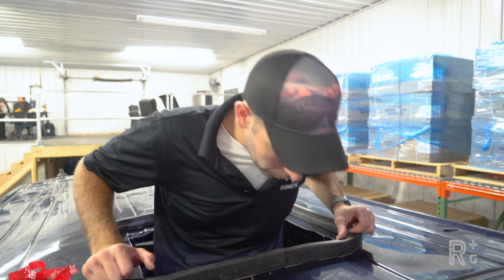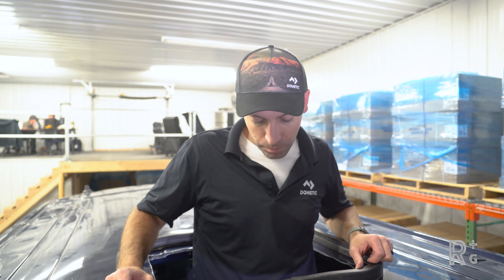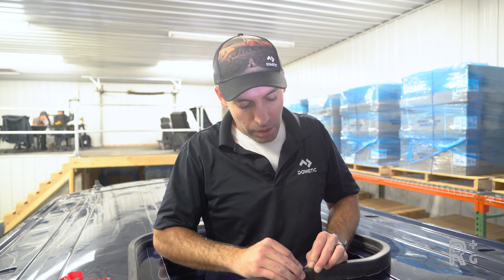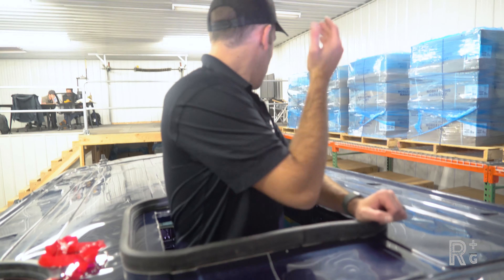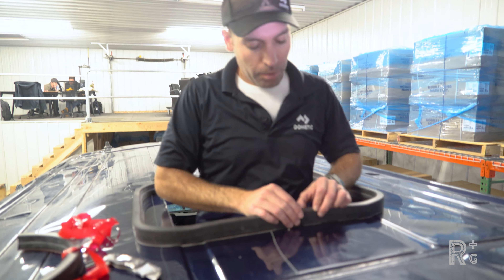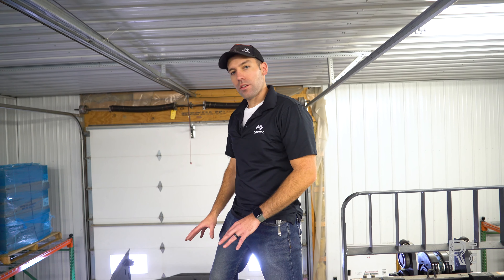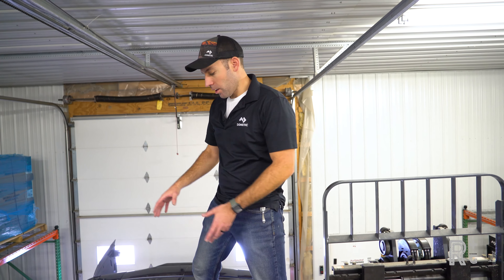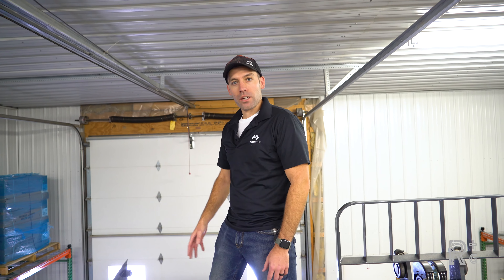Our gasket is installed. There's a little bit of a gap, but we're going to come back through with RTV sealant — get some in between the gaps, underneath, all the way around — to get this sealed up really nice and watertight. We put the seam in the back because with the forward direction of the vehicle, wind and water won't penetrate that gap. Now we've got our RTX in position for a quick dry fit — before we caulk anything or apply RTV, we're just going to lay the RTX in the hole, check from the underside to make sure everything lines up, then take it off, apply the RTV, and show you the inside.